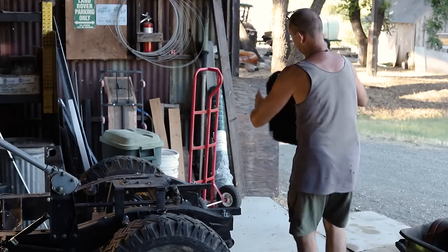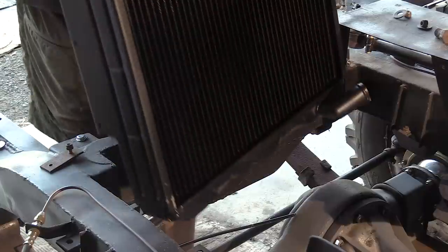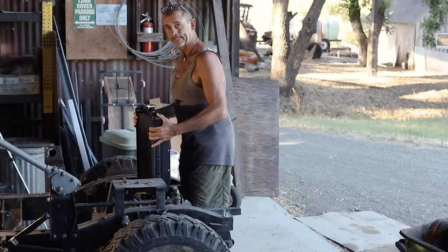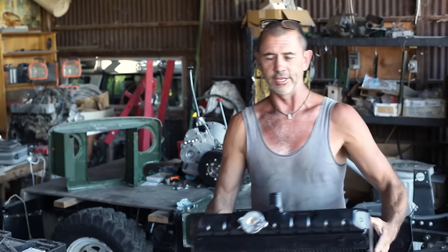Series 3 radiator. And pop that in there, and oh, too wide. Okay. Oh, we can see right there that if the V8 goes back into the truck, then installing this radiator could be quite problematic. We're just not going to have the space, it looks like.